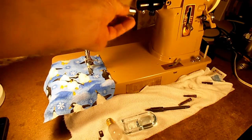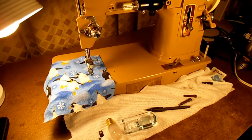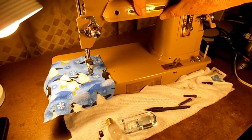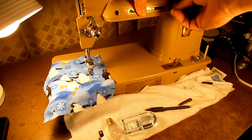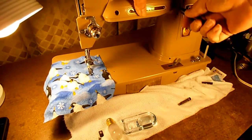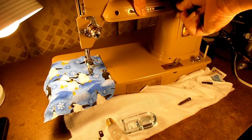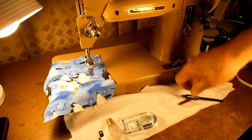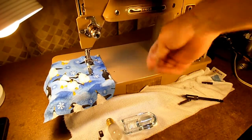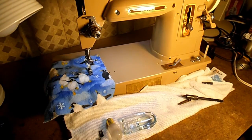This has cooled off now so let me take that out. You put in the LED the same way — for this model, pins up and down, push it in a bit and turn it towards you. Then I'll put the lampshade back on with one screw just to save a little time, and then we will try that out. I don't have a temperature gauge or a light meter, but it would be interesting to compare readings.